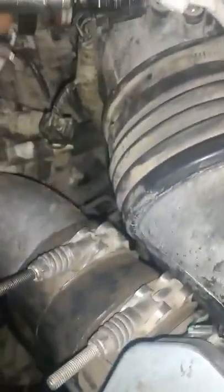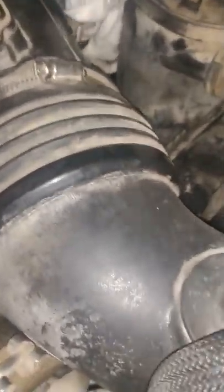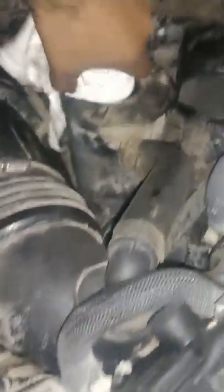Then we're going to go over here where your oil cap is. You remove your oil cap, put your air nozzle right in here. You're never going to overpressure the system — don't ever try to get a complete seal, you don't need it. Don't remove your filter; you don't want anything escaping back through your cold intake. I'm going to put it in here. I don't need much pressure — I don't even have to cover it. This one's very, very small — a pin wouldn't fit through it. That's how small it is. But with the heat, the aluminum will expand, so it will open up. Let me see if it will do it now.